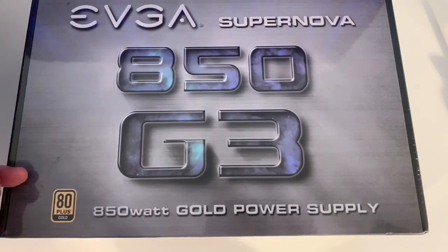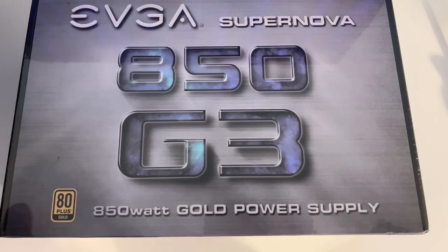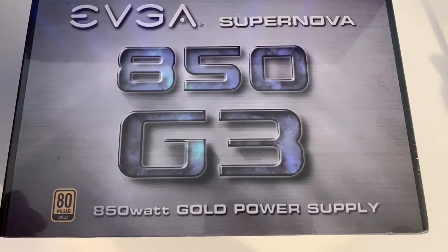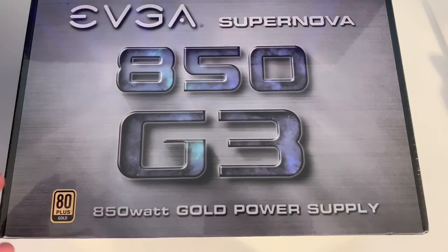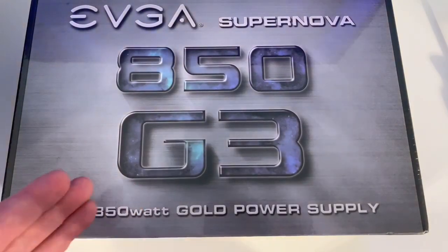If you're drawing 250 watts, a basic power supply is going to be pulling about 312. If you have a bronze, you're going to be pulling 304. Silver, 294. Gold, 277. Platinum, 271. So the difference between gold and platinum is only a couple watts. It doesn't make sense to buy a platinum power supply when you could buy a gold, because you're only getting a few percent more efficiency. For 99% of people that are going to be using this, the gold is going to be fine. It's much more efficient to go with a gold than a bronze, but you're only getting about 2 or 3 more percent efficiency going with a platinum over a gold.